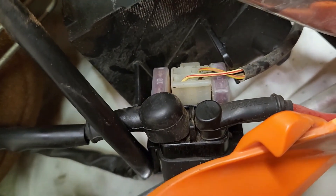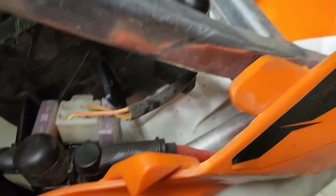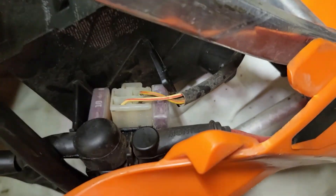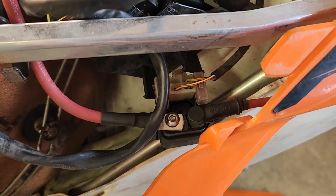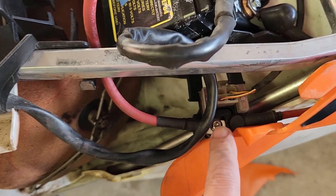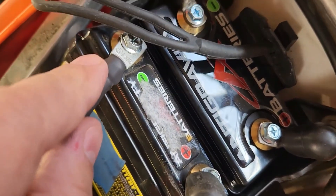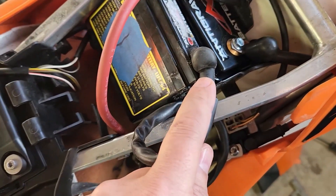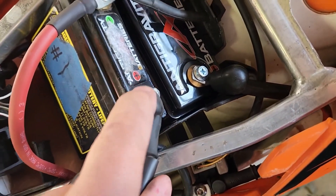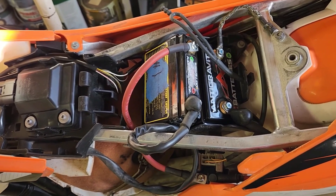Turning it upside down, you can see the cable that goes to the battery on one side, and the cable that goes directly to the starter on the other side — the solenoid makes that connection between the two. For the 24-volt conversion, I've removed the cable going to the starter and attached a new cable. This red wire goes up to the negative terminal on the auxiliary four-cell lithium battery, and the cable that used to go to the starter side of the solenoid is now connected to the positive terminal. You will only get 24 volts when the starter solenoid is engaged.